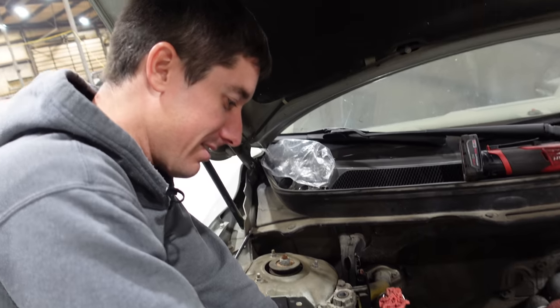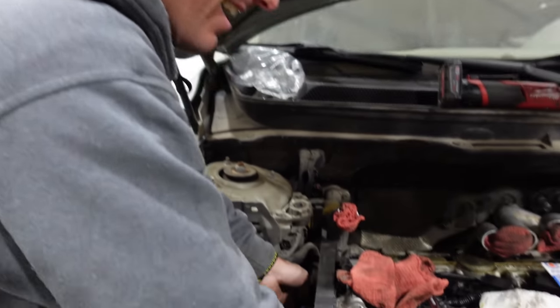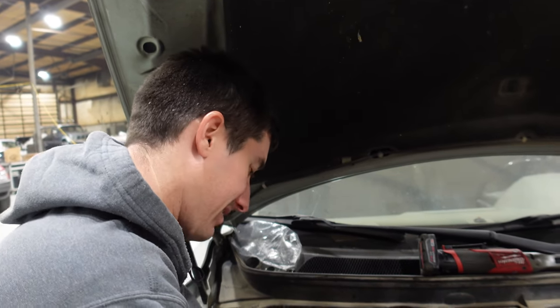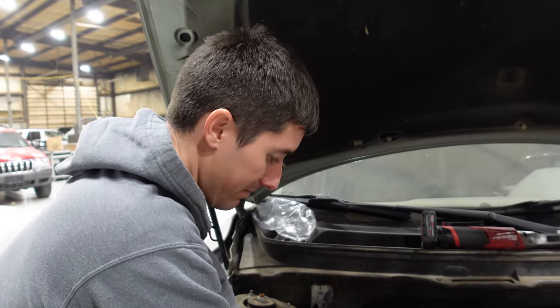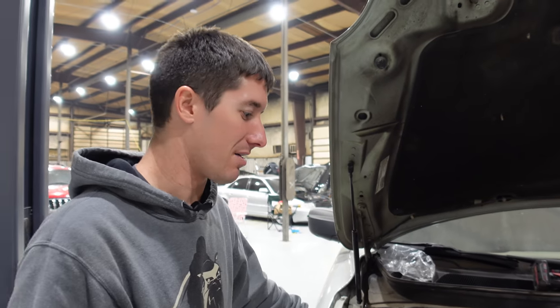I would say it's done. I don't know the torque spec but it's hand-tight, and it is a metal gasket that crushes. I definitely don't want to strip these screws because it is all aluminum. So we're ready to stick the covers back on and reassemble all this good stuff. The only thing left is those hoses.